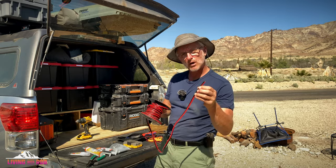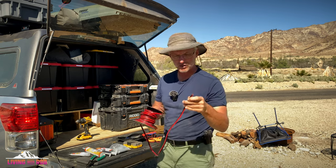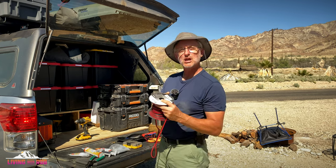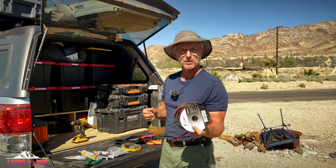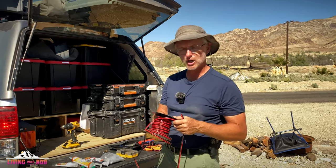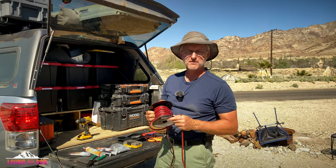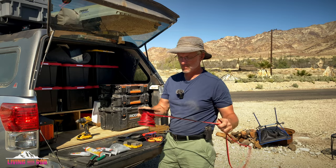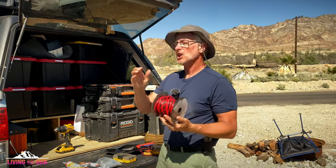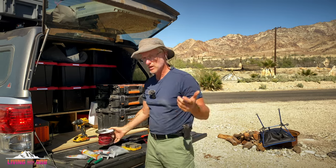But you're gonna need your 12 gauge wire to run your solar connection to connect to your other panels. Don't cheap out on your wiring. Don't buy aluminum wire, buy copper tinned or solid copper wire. It does cost more, but the conductivity of it is much greater. You're penny wise and pound foolish if you buy aluminum wire. Make sure you're buying solid copper wire. Link in the description for all of the relative things that you're going to need, including the solar panel.